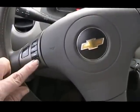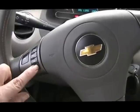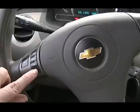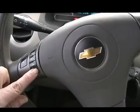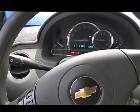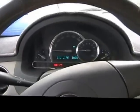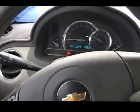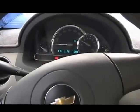Okay, I pressed the button down once. Nothing said acknowledged. I let up on it. It said oil life acknowledged, and I pressed it again. And then it said acknowledged and 100%. Okay, we're good. Start it back up. Now I want to go outside and check for leaks.